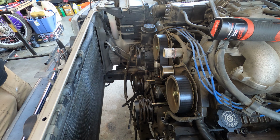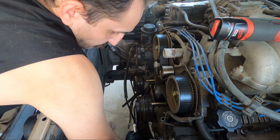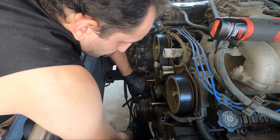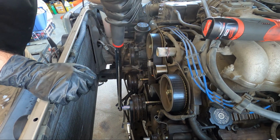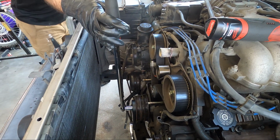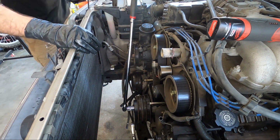It's on there tight. Here I'm attaching about a 2-foot ratchet on the end of the tool, and it's butting up against the frame so that when I go to loosen the pulley bolt, the pulley cannot turn. Now I'm attaching my biggest 1/2-inch breaker bar here. Now I'm going to apply pressure here and loosen the bolt. There we go. That's all it took.